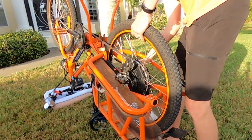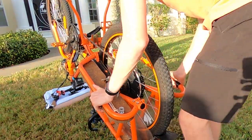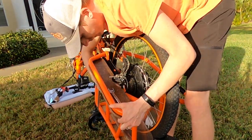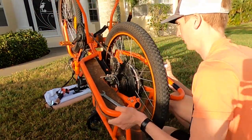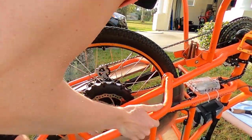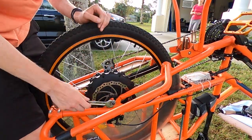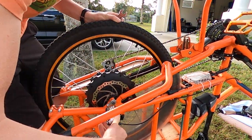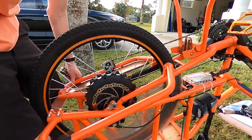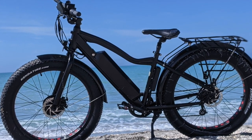At this point, presumably your tires are pumped up and you've made sure that the tire liners are installed evenly, so you can install the wheel back on the bike. This process just reiterates the fact that you definitely do not want to be doing this while you're out on the road. Bolt on the rear wheel and be sure to reinstall any torque arms that you removed, as well as any electrical connections that you disconnected. The process for installing tire liners in the front wheel is likely to be easier, especially if you have a quick release.